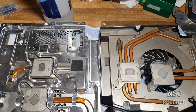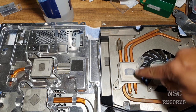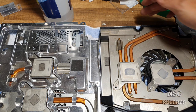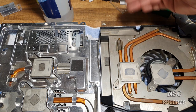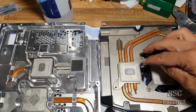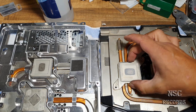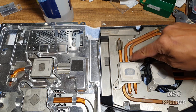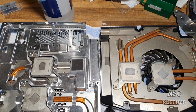If you feel the back with your hand it's only a little bit warm — not that hot. This is a sign that the heat is just staying inside the heat spreader and the CPU itself. The air on the back is not as hot as it should be because the heat cannot be transferred through the heat spreader and then through the heat pipes.